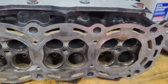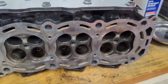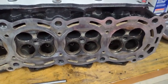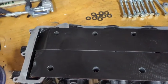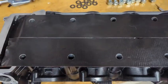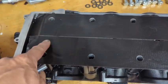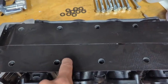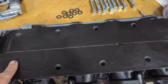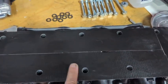Next, we're going to apply the bottom plate. I can't emphasize this enough — really clean that surface. Make sure there's no oil that dripped down while putting the other plates on, as oil can run down. Clean it one last time, then apply the tape. This is what it should look like when you're done with the tape on the bottom. I did it in two pieces — just make sure you don't have a gap anywhere near the holes for the water to go through.